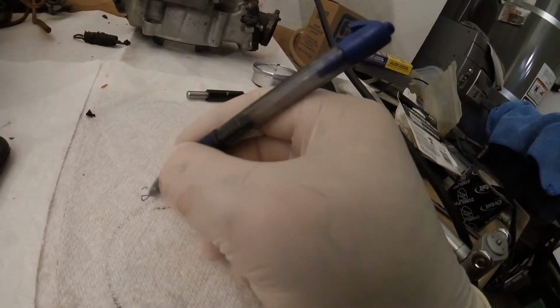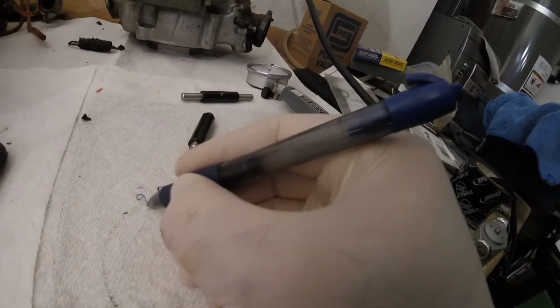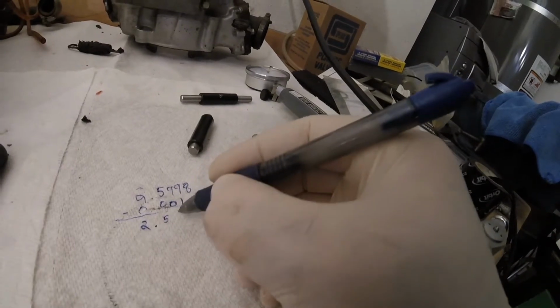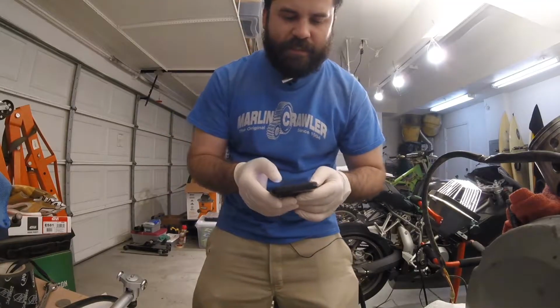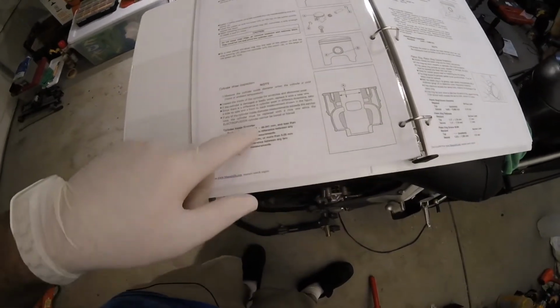So when I said that we were 1/1000th of an inch under what we had set the micrometer for, I'm going to have to do some math here. So we set for 2.5998 inches. And we were reading approximately 1/1000th of an inch less. So we're at 2.5988 inches, which is basically 66.00952 millimeters. Basically, we are still within the standard cylinder bore.